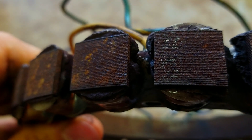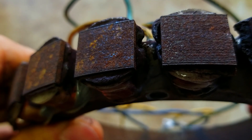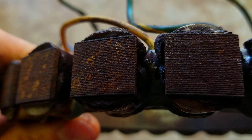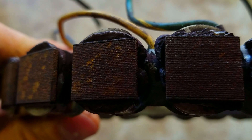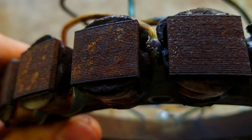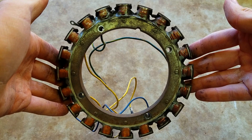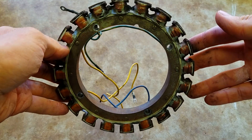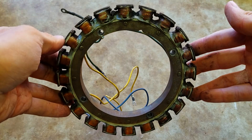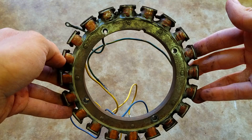What this black stuff is — it's an insulator that insulates the inside of the coil. What happens is, when the motor gets hot over time, that black stuff oozes out. Now just because you have that black stuff oozing out of your stator doesn't mean it's bad, but it's definitely a sign that it's time to replace it. You can take your chances and see how long it'll last, but it's only a matter of time before it fails if the stuff's oozing out.